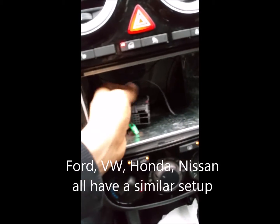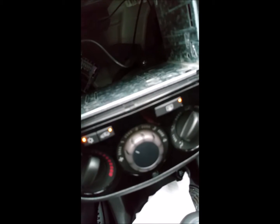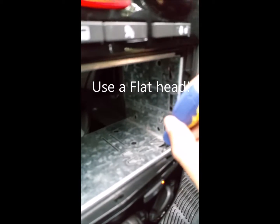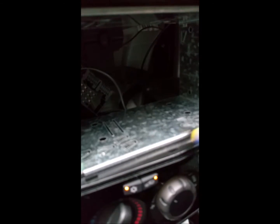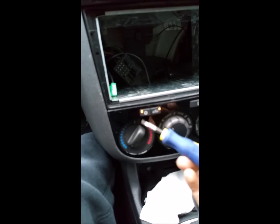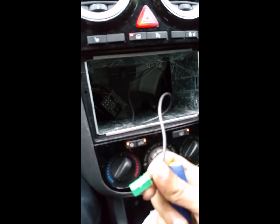I've just basically unplugged that loom from here — there's a clip on the side. This is obviously a Vauxhall and you'll see similar ones in the Astras and other Corsas; it won't be any different along with the head unit cord. So that should be live and you can use that. Then this cage would come out by pulling up these clips with a screwdriver, like so. You can just basically push those back up and then it will literally just slide out again and lock in place. Or you can remove this and put back in the stock one — that's basically how you remove that cage. And then this plastic trim that comes with it — you can put back in your original, or when installing you would slide this cage in, bend in these bits so it clips in, and you're good to go. I'll then show you how I installed the microphone and threaded that through from the sat nav.